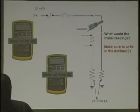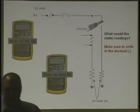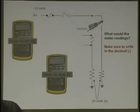Okay. Now, also, if you're using a power probe, you'll notice I know I'm connected. How do I know I'm connected using this power probe? I got the green light. If I'm not connected, no green light. Everyone understand that? So the power probe could also be used as a continuity check. I got it green. Okay?